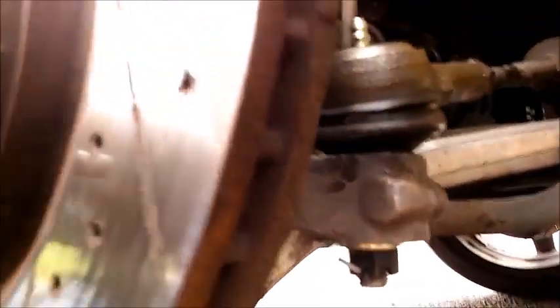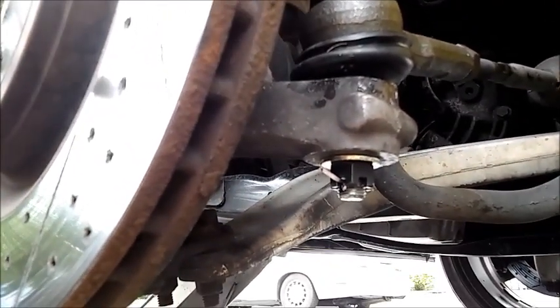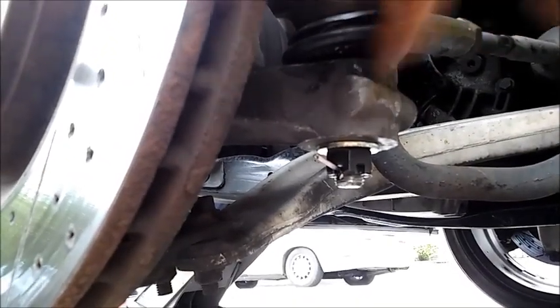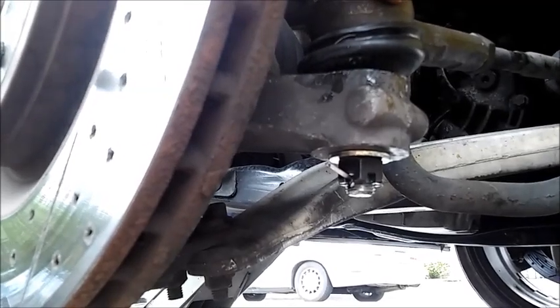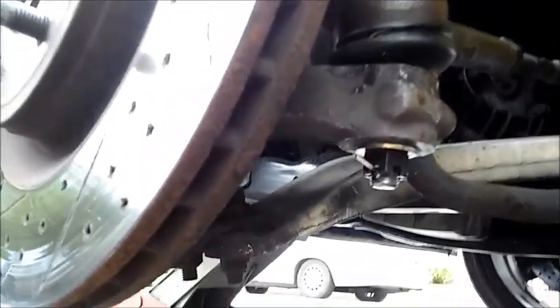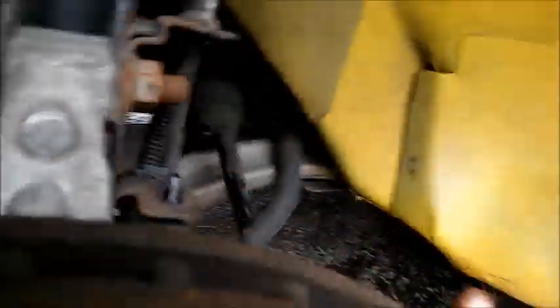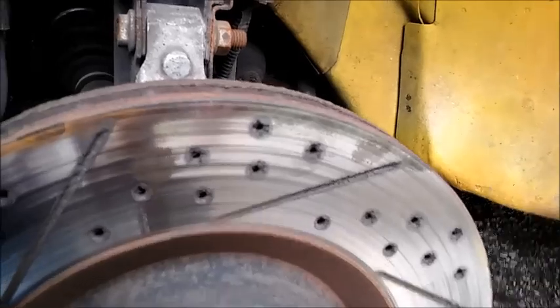Just bend it out. The grease fitting is out — I'm not going to grease it because it's got a lot of grease from the factory. If you're taking the tie rod out and you don't have the fork separator tool, you can hammer on the stud directly to break it loose — if you know 100% the tie rod is bad you can do that. Hope this helps. It's about a 15 minute job. Most important thing: keep track of where the tie rod was originally to keep your alignment. Thanks for watching.